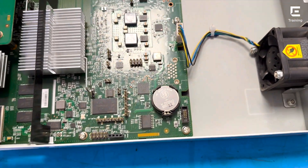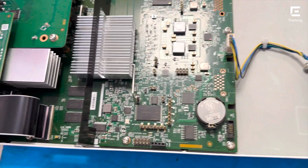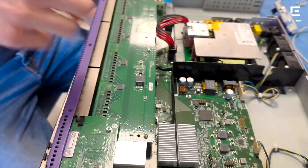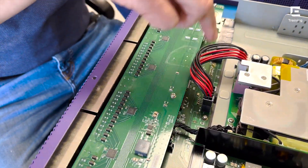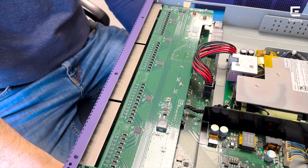You could have other voltage rails working here too — 5 volts, 3.3 volts, and one volt for some of the ASICs. Your SFP ports work at 3.3 volts. And you have your Power over Ethernet circuitry here as well.